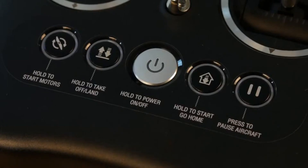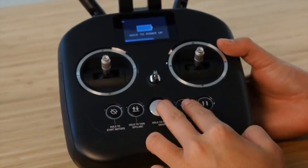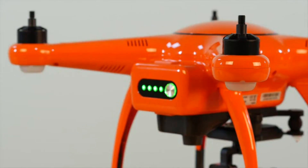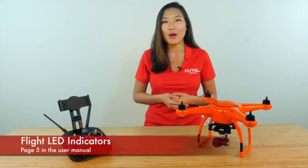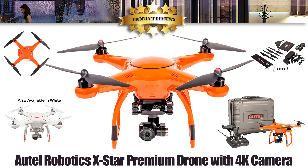Now, on the remote controller, press and hold both the power button and the go home button simultaneously until the remote controller powers up. The indicator light from inside the aircraft will now turn a solid green, and the 'connect your aircraft' message on your remote controller should disappear. You will also notice the aircraft's rear LED lights will change color or sequence from the fast flashing yellow. The new LED sequence may vary depending on your environment — you can learn more about LED light sequences on page five of your user manual. Now that your X-Star Series remote controller and aircraft are paired, you're ready for flight. If you have any questions, give us a call at 1-844-MY-AUTEL. Thanks for watching.